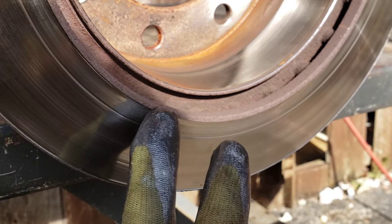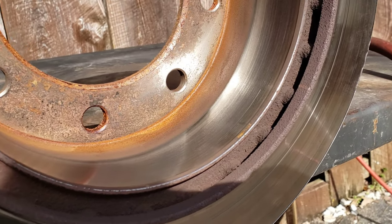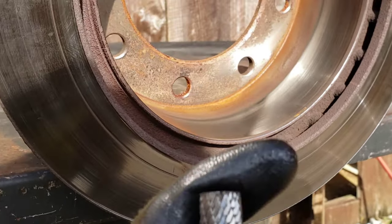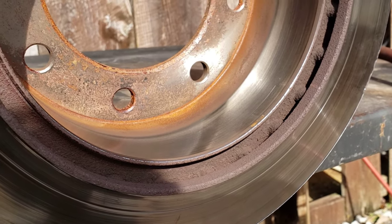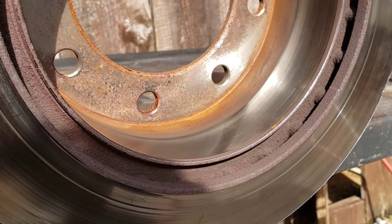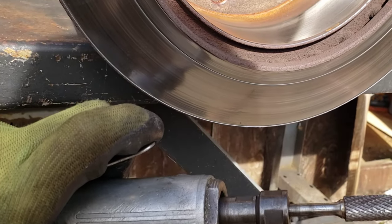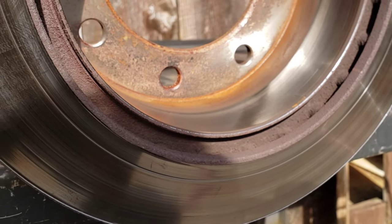I'm not touching the disc rotor at all — only right here on the drum surface. I'll be using a deburr rasp, whatever you want to call it. I'll attach a picture of the exact one I'm using. I don't want to take a lot of material off or cause the rotor to become imbalanced. I just want to texturize it because I don't have a bead blaster. I have a sand blaster and tried using that, but didn't have much luck. So I'm going to roughen the surface up and show you after I get a bit done.